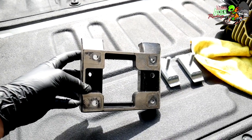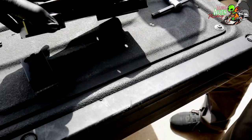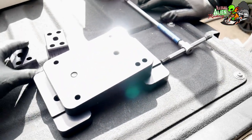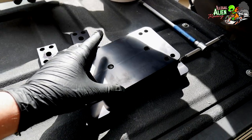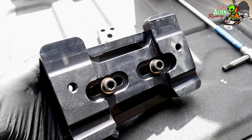We're going to replace this old motor mount with an Odenthal five-degree mount. The engine sits on the top plate, and that top plate moves back and forth — it makes changing the tension on your chain a whole lot easier than the mount that was on it before.